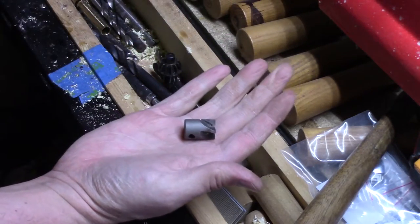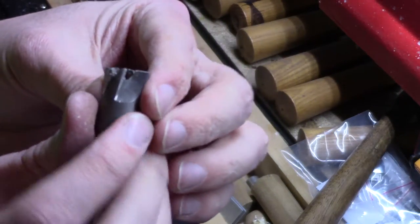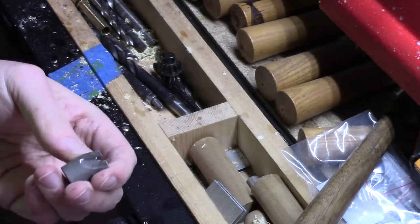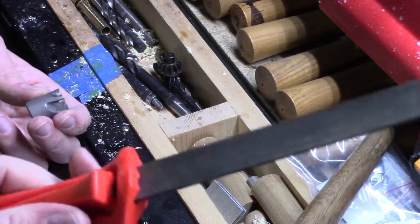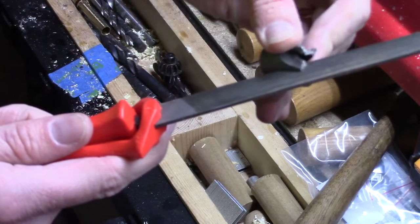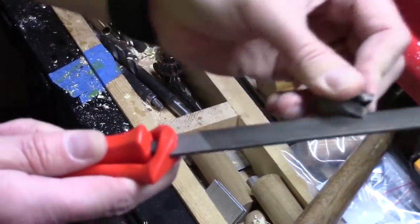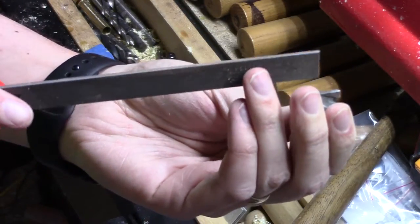Get this piece out. As you can see on this, it's got these little slants, and the back side of it — that's what you're going to want to file. So what I'll do: I've got a flat file, it's just the file I keep with my chainsaw. Just lay it down flat on that — it angles over — and just run it back and forth.